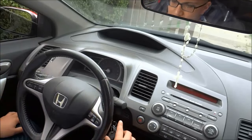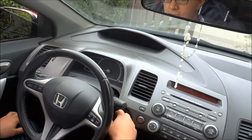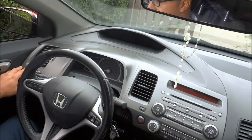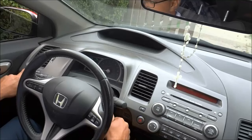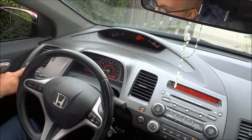The first step is to make sure that the car is off completely — the key is completely turned off. Then you are going to hold the select button down, just like this. Hold it down, turn the headlights on, turn the key to the second position, headlights off, on, off, then push select one, two, three.